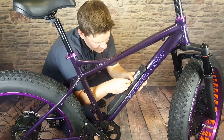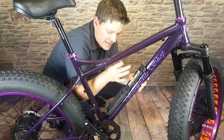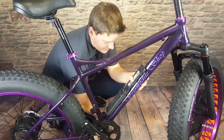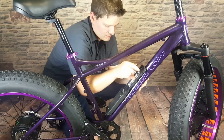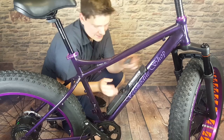Another problem I've seen with some cradles is if the head of the bolt is too fat, the battery will not go on. So if you have trouble getting the battery on after you bolt the cradle down, check whether the bolt head is too fat and preventing the battery from sliding on. Go ahead and tighten both bolts to where they're just snug so you can still slide the cradle up or down a little bit if needed.